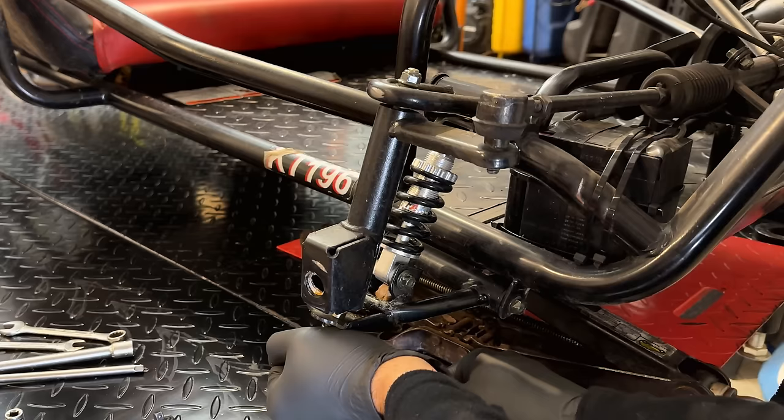I did quickly just double check the dimensions of some of these parts that I can reach and compared it to the other engine. And we seem to be in the ballpark, if not an exact match. So I think I'm going to keep going on this one. We'll get the cap off. We'll get this crankshaft out. Do the same on the other engine. Measure things up a little bit more carefully. And if it looks good, we'll throw the other crank in here and close this one up.